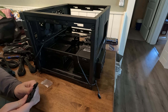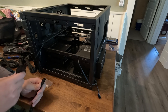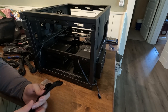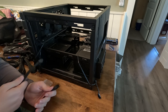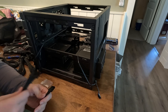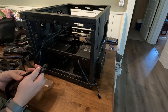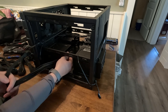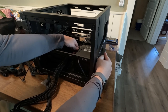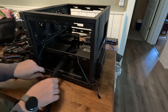Cutting power supply cables isn't always a good option — you should only cut them if you have an electrical background and know how to cap them properly. These things will short out really easily, especially older ones; one or two good pulses of electricity and the power supply is permanently dead. Tie cables off somewhere out of sight if you can. When the connector is in, the safety catch will drop down — sometimes you'll hear a click, sometimes you won't — but once it's in, if you pull backwards lightly, it's not going to rock or give.